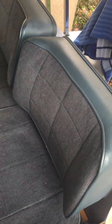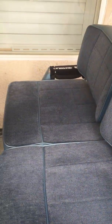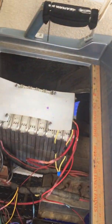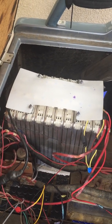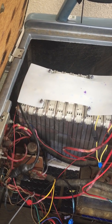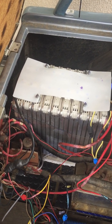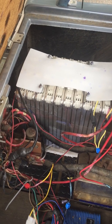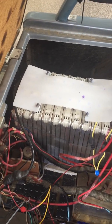Within a few months I found out I either needed to go with regular batteries, or after looking around, a lot of people were doing lithium packs. So I went ahead and replaced the six six-volt batteries with a 10-cell lithium battery pack. This cart was originally 36 volts, and the 10-cell pack ranges from about 36 volts up to about 41 or 42.